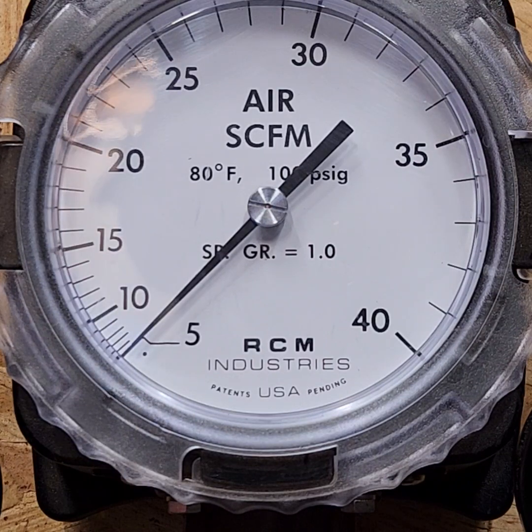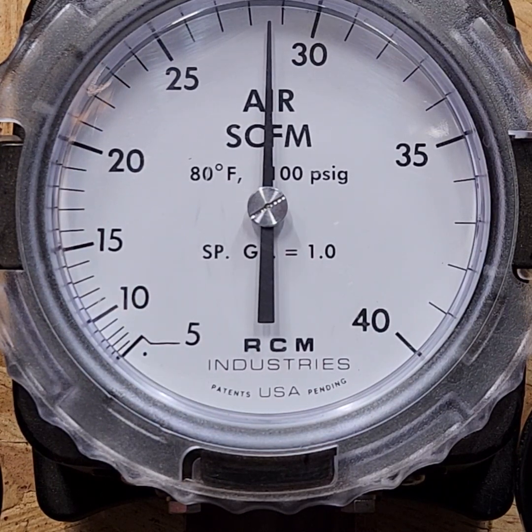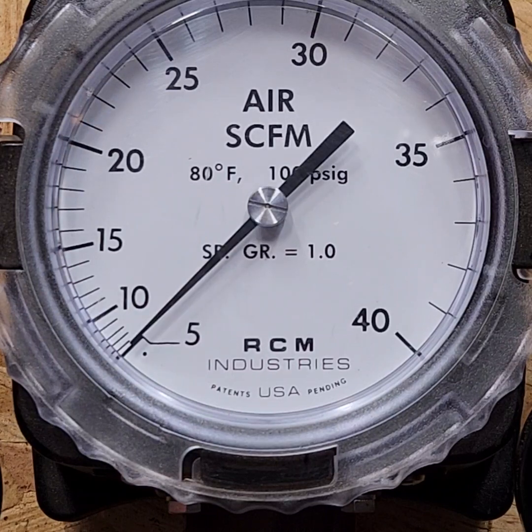And then last, we've got an air band file. It's a half-inch wide by 18-inch air band file, also rated at 4 CFM. So what is that, 28.5, 29 CFM? So again, there are some different variables here. They all have an assortment of plugs, although the plugs are fairly standard bore. But that's just to show you the magnitude of what we're talking about.